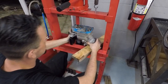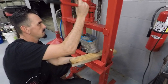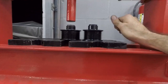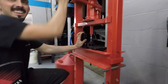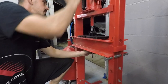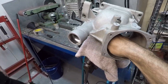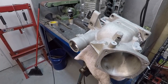The idea is to press the shaft out and then pop that pulley off. There's our 2.31 pulley — look at the difference, pretty substantial. Cleaning off some of the ugly silicone. This thing is fugly, but it's had some major surgery on the top and the bottom. Right now we just got to clearance this guy and knock that thing down so we can take on our 2.31 pulley.